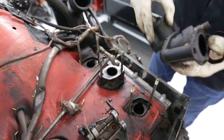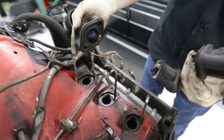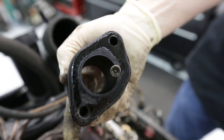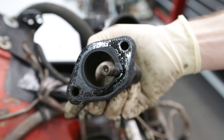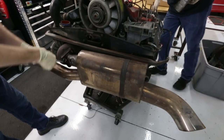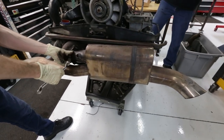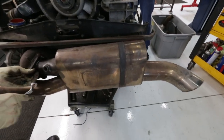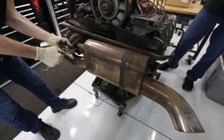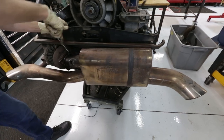Our fuel injectors are pointed directly at the back of the intake valve, just like all the late model cars. Helps with mixture. And like you said, these injectors open on fuel pressure. Strictly pressure. Yep. They have a popping pressure to open them, and then they just flow more as the pressure increases. An analog fuel injector, check that out. 100%. Up next for removal is my B&B exhaust system here. We're gonna be replacing this with a proper flowing Turbocraft muffler, piping and all that jazz.